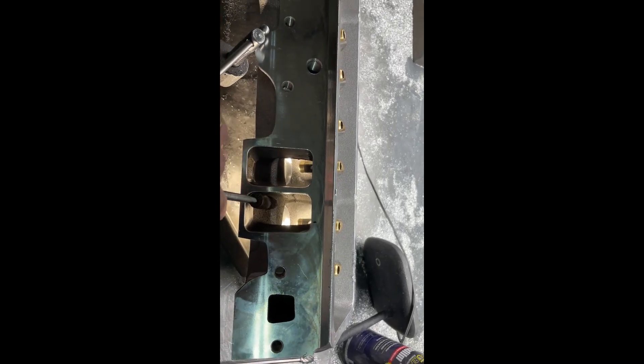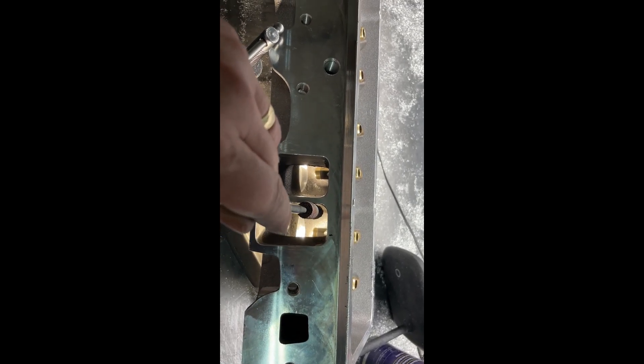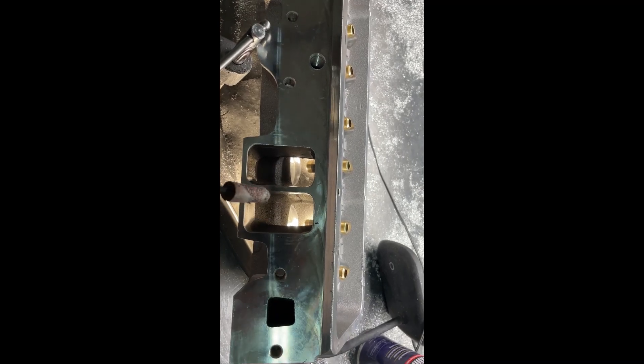This is a mandrel that holds a cartridge roll. I use 40 grit after I've done the port work, then this pink stone. With cartridge rolls, just like carbide burrs, if you go back and forth you will end up dug in on the sides. So again, just lift up and go in one direction — lift up, down, down, down — and the lines come out straight. If you just leave it dragging back and forth, you'll end up with corners dug out, high in the center, and it looks wrong.